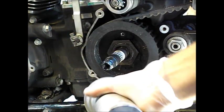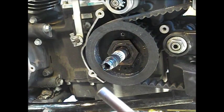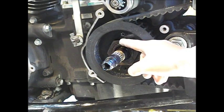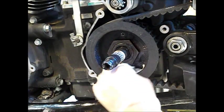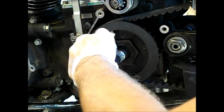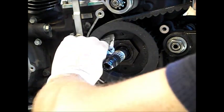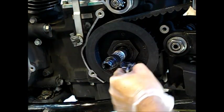We'll back off a little bit so you can see more of that. He also said, don't be afraid — go ahead and put a little heat to it. Now, you have rubber gaskets here, so he said if you're going to put heat to it, put the heat along the outside edge quickly, and that will help soften up a little bit of the Loctite material holding this nut on. Then just go for it — give it some pressure and get in there. So that's what I'm going to do.